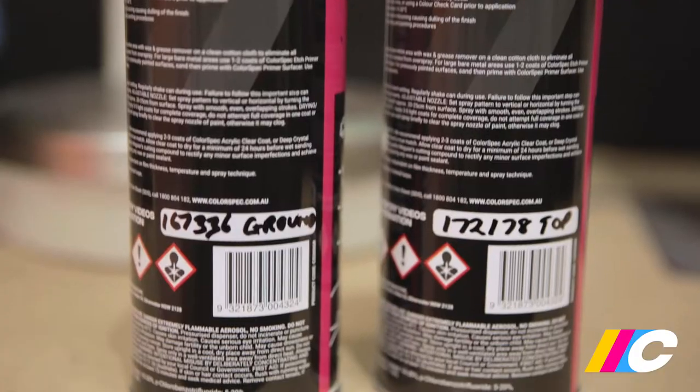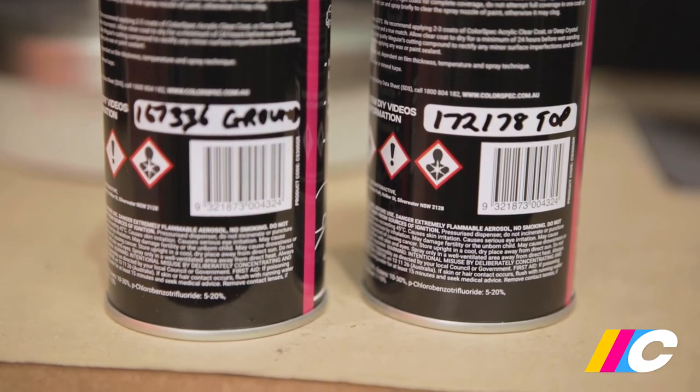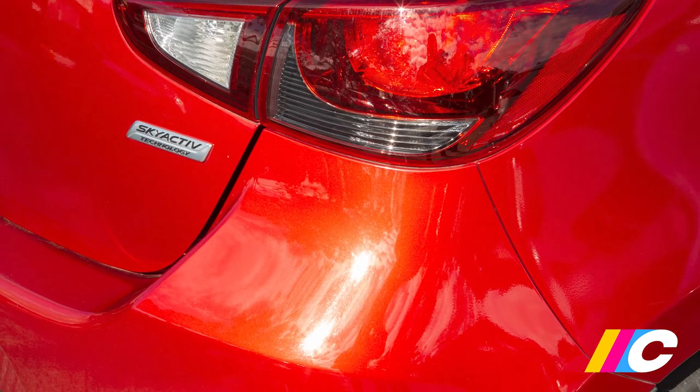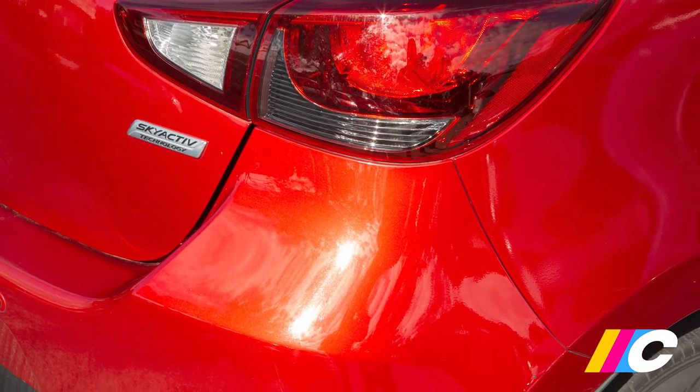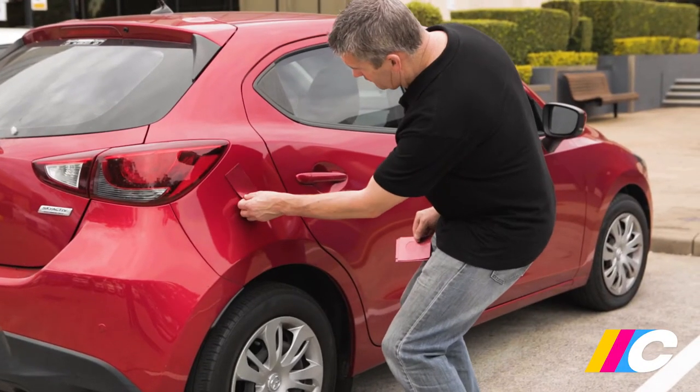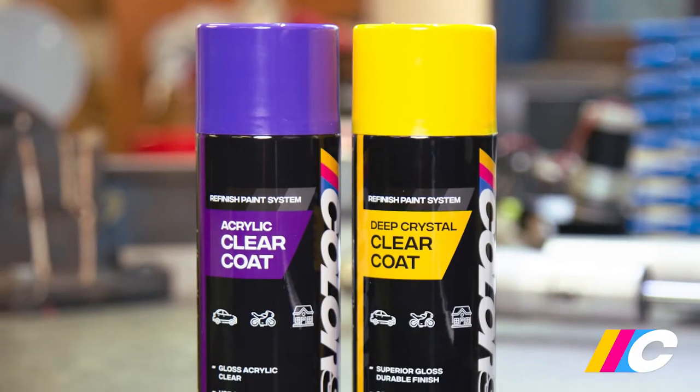To achieve their distinctive look, multi-layer pearls require two base coat colors: a ground coat and a top coat. The top coat is semi-translucent — it not only creates a pearlescent effect, it's also what makes matching multi-layer pearls more involved. There are no shortcuts; using a separate ground coat followed by the top coat is the only way to match the vehicle's factory color and look.